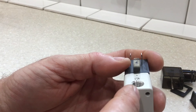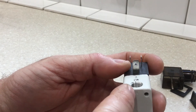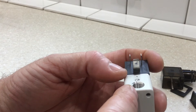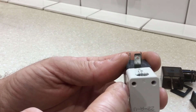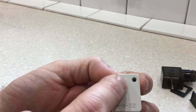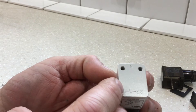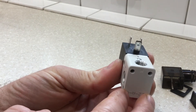You'll need one component to install this, which will be an eighth-inch national pipe to the tube size. I have some push lock fittings — I'm going to put one of those on, just a straight-through push lock. They make a mounting plate kit for this that would screw down on these holes, but I decided to use the existing mounting plate because the dash is already drilled and tapped for that plate.